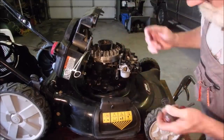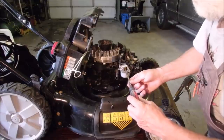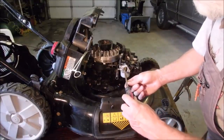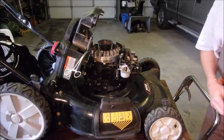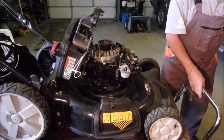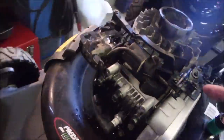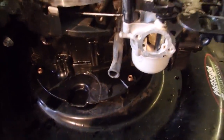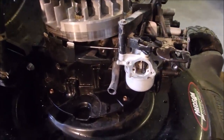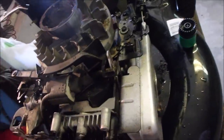And it's activating now. Now, before, remember when I was doing it with the screwdriver, you guys with me? Yeah. I was poking this in. I didn't feel that resistance there. And these always wear a little bit. I'm going to just adjust. Oh, I'll show you what I'm going to do. Okay, there is. Now the heat on the muffler warms up. There's a bimetal strip, and this thing goes like that as the engine warms up. And as the engine warms up, it opens the choke. I'll back up. See, as the engine warms up, it opens the choke. There, see that? That feels good. It didn't feel like that before.